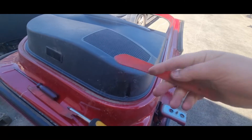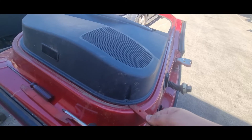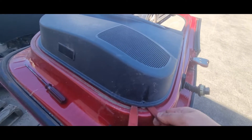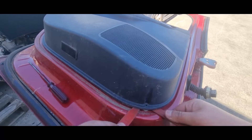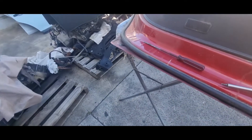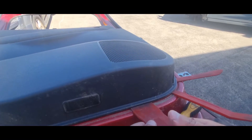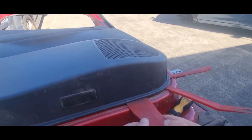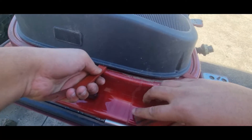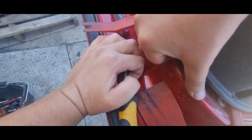This is the more important part of the process. The only thing that holds the door trim onto the door shell is clips on the inside of the door trim. For this part I would use plastic tools to open up space so my fingers can fit between the door shell and the trim, and finally I will pull off the door trim. The clips on the inside might break or might not — it's one of those things that's hard to control as you can see pulling them apart.